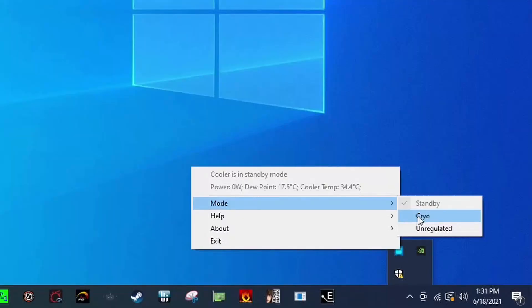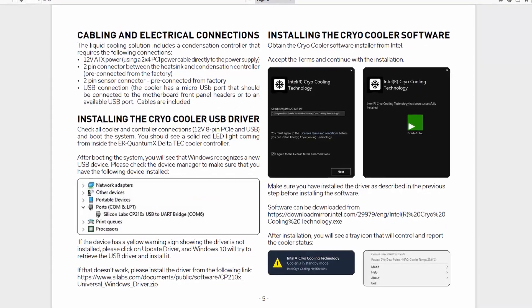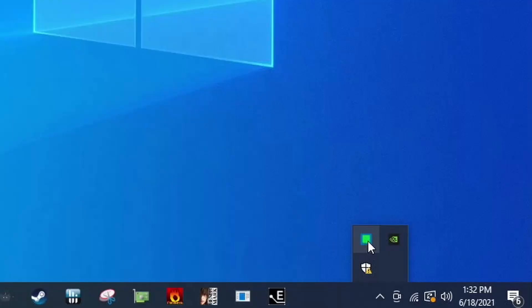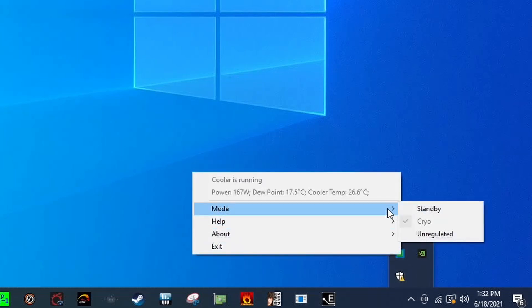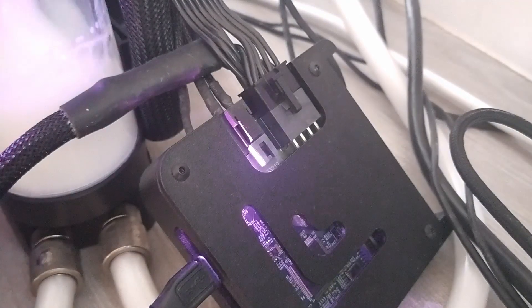In case you forgot, let's remind ourselves of the difference. In cryo mode, the Peltier element inside the Quantum X Delta Tech water block is only switched on when required and switched off when not required. This greatly reduces overall power consumed, as the tech is not running at full power all the time. The Intel software regulates cooler temperature by assessing humidity and CPU temperature, ensuring maximum cooling while preventing condensation. This mode is indicated by a green icon in the desktop tray and a green LED on the tech controller. In unregulated mode, the Quantum X Delta Tech cools well below ambient temperature with less protection from condensation, indicated by a white icon and a purple LED on the tech controller.